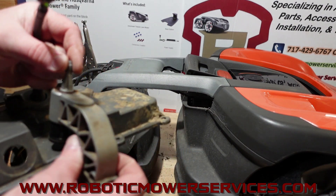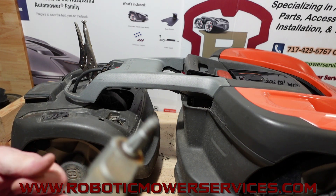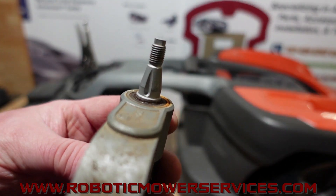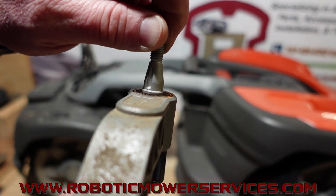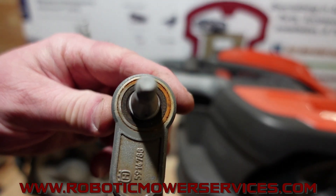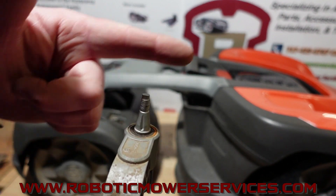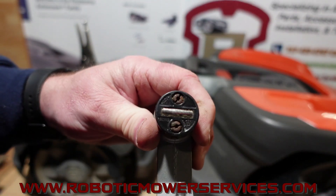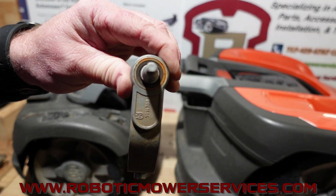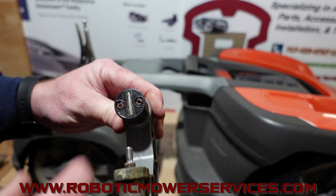It's not the shaft moving — it's the sensor board itself moving underneath. To help you understand better what's going on here, let's talk about this shaft. If I can get my camera to focus — there's a keyway right there, and 180 degrees there's another keyway. There are also flats across the top here, and that is what I've got my vice grips clamped down to on the flats. The way these flats are facing corresponds to the way that magnet is facing, so if your magnet is 180 degrees from the arm, then these flats will be 180 degrees from the direction of the arm.